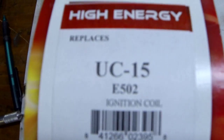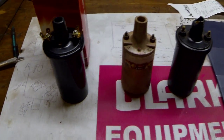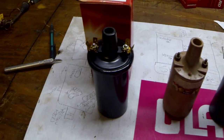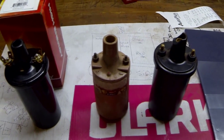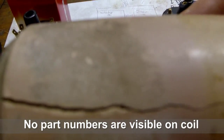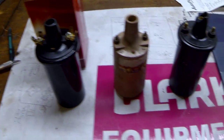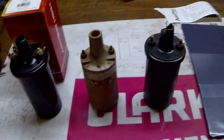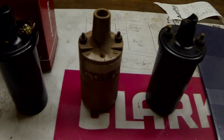All the other stuff was standard, that's why I thought it was standard, but this is a high energy UC15 E502 ignition coil. Here's the problem: I put the brand new coil on and she won't even sputter. I put the old coil on and she'll start and run. I don't want to put the old coil back in the machine — she is split down the side in two spots and I know if I put her on there she'll get moisture in her. I was going to wrap her with electrical tape but I thought no, I'm putting all the money into points, condenser, rotor, and cap, so I want to get a new coil.